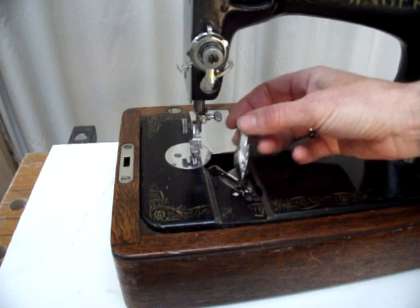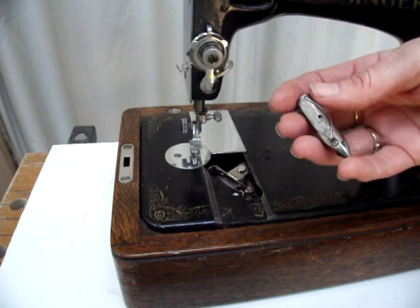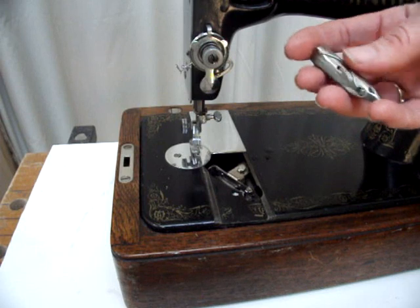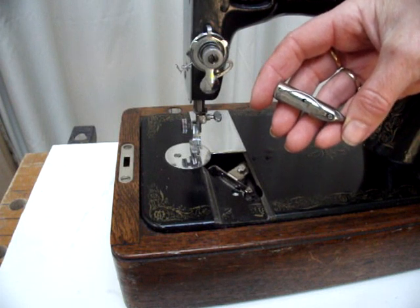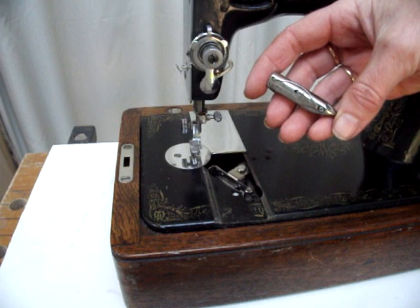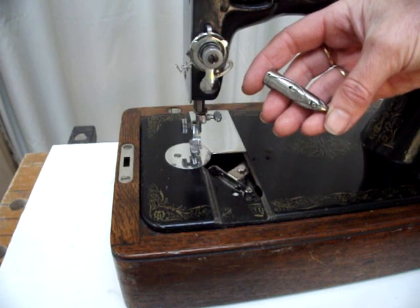Remove the shuttle carefully with your fingers. The reason I say that is because this part of the shuttle, this thin cut out plate screwed on the top side, is the tension spring, and it is vitally important. Never try to get a shuttle out by pulling at the tension spring with your nails, or worse still with any metal item like scissors, pins or screwdrivers.